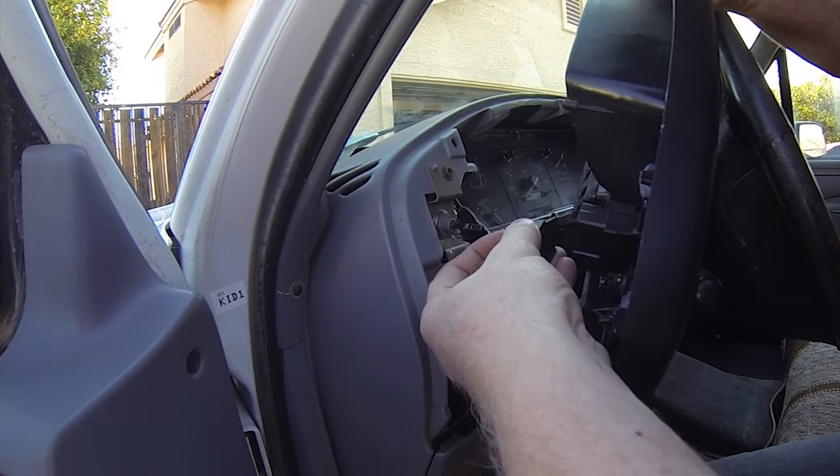Low fuel pressure could be a result of various issues — most people immediately jump to the fuel pumps. This particular truck has two fuel pumps because it has two tanks, which adds complexity. So the first thing we're going to do is bypass all the electronics and the engine controls that regulate when the fuel pump turns on and off, and go straight to the fuel pumps to see if they're actually working. Rather than immediately saying we need to replace a fuel pump, let's check it first.